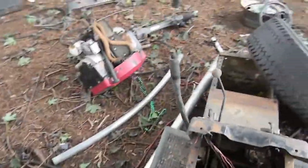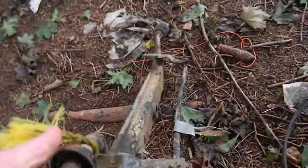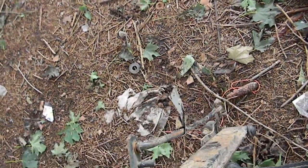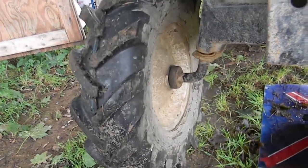I also think I'm going to replace the front axle entirely. The front axle that came with the other Craftsman is in decent shape and it has grease fittings — Dinky does not, I have to take stuff apart when I want to grease it. The other one is in worse shape though; the tire's a bit off balance because of all the JB weld and the bearings look worn out. But this one on the other hand is going for days, and it actually has more clearance.